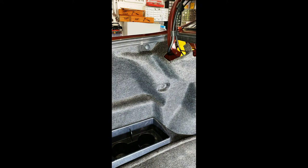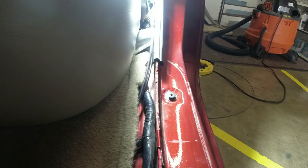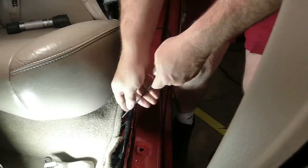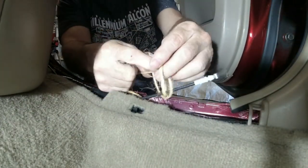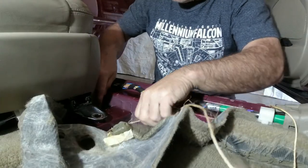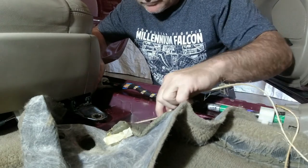I started my cable routing from the trunk. Pull this side wall back enough to look inside and you can see the old cable routing. Just start routing your new cable through the same hole the old cable is coming out of. It'll pop out right next to the back seat — go down that side wall to the floorboard. It's a very straightforward and easy routing through here and there's only one plastic clip holding all this in place. Routing it from the back seat to the front seat is a little more tricky. What I did in the front seat was tie a string to the broken cable, then pull on the cable — this showed me which cable in the back seat I need to pull on. From the back seat, pull the bad cable out until you get your string. Remove the string from the bad cable and tie it off to the new good cable. Now move back up to the front seat and start gently pulling on the string. You'll pull the new good cable all the way underneath that carpet and it'll pop right out. As far as I can tell the carpet's the only thing holding the cable in place.